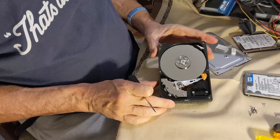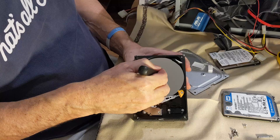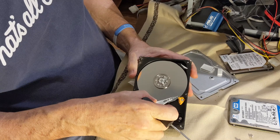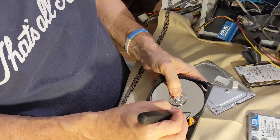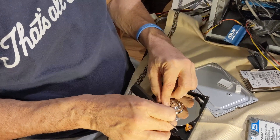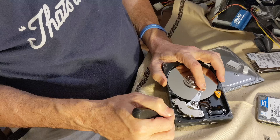This is the geometry of the inside of a hard drive. That is the hard drive platter — the actual disk — it spins. That's the hard drive head, which spins in and out to the various tracks. There'll be tracks one, two, three, four, five, six, seven — up to whatever — and the head moves between tracks and sectors, because if you imagine it's cut like a pizza pie you have all these various sectors and the hard drive reads them. Now, to be able to move so fast it has super magnets. The magnets are there and there — there are two of them.